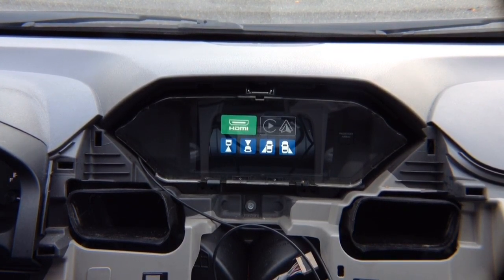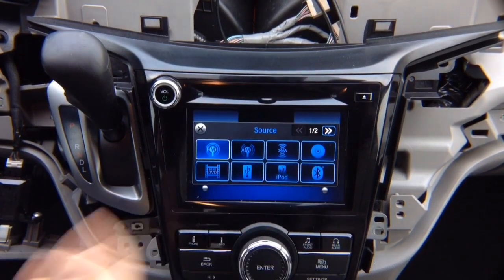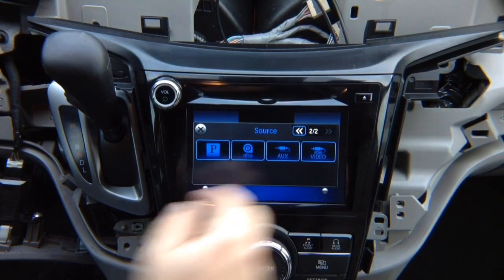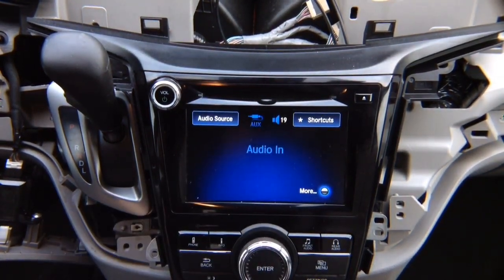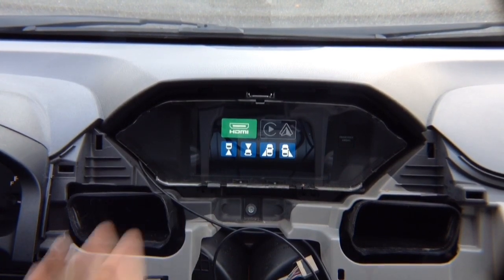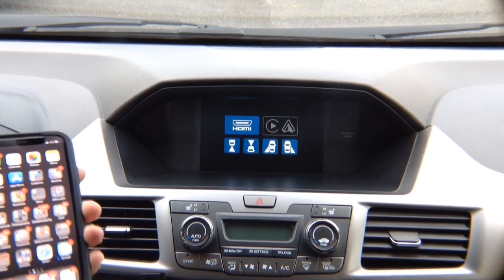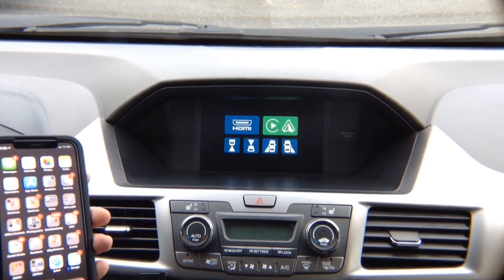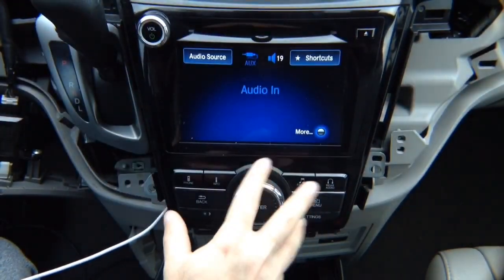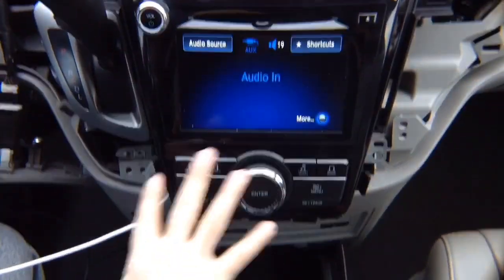On the radio, go into the audio source and set it to auxiliary. This way you'll hear audio from all your sources such as HDMI or Apple CarPlay and Android Auto. Set the radio to auxiliary so your auxiliary audio input is active. Now test the audio through HDMI or Apple CarPlay — it's the same source. Connect your iPhone and CarPlay will appear on the screen. All controls are done with the factory joystick — the back button, rotate to control everything — basically done through factory buttons just like it would come from factory.